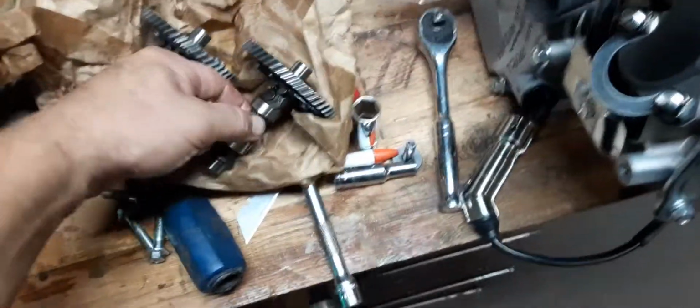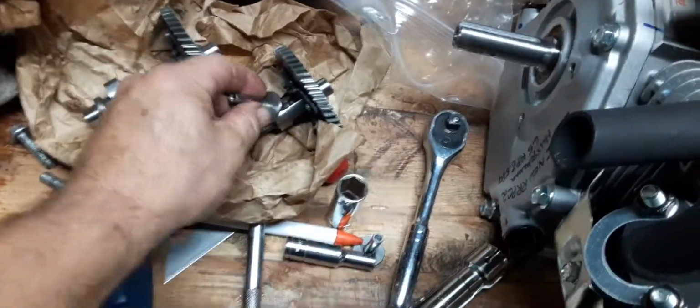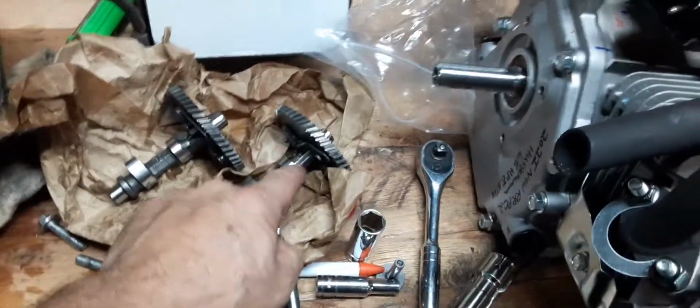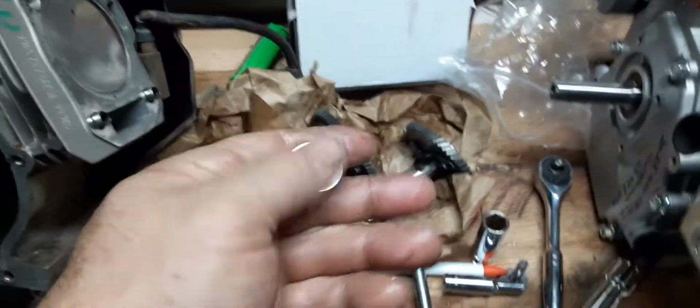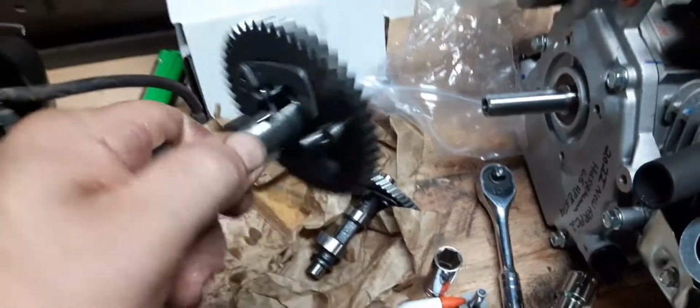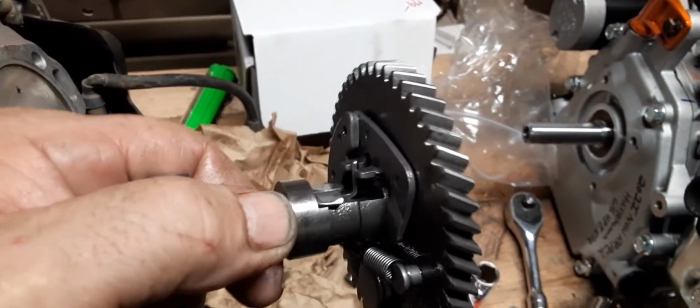So when you look at the new cam, it flows across it. See that? So there'll be excess wear on your lifter. So note that if that's like that, you need to find out what the specification is for that. But if it is too high, you can take it down a little bit, because you can see how it's wearing itself. See that? And I'm glad I noticed that. But just a little update.